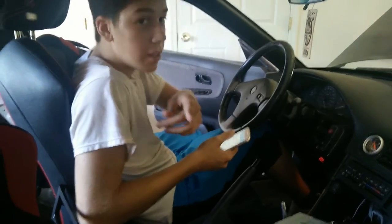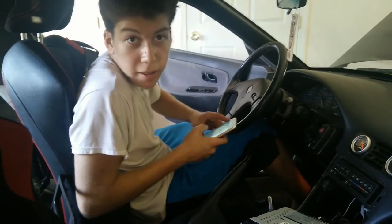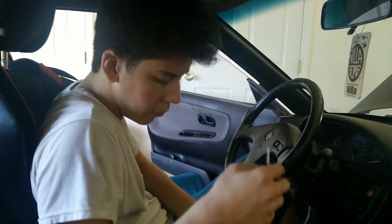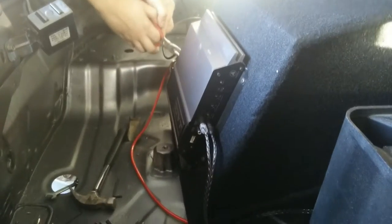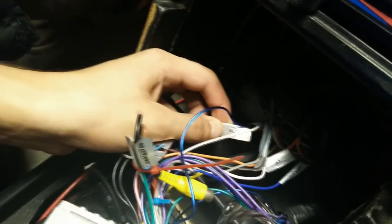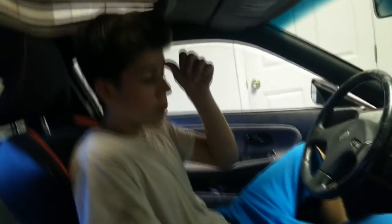Hooking up Bluetooth, Bluetooth life. Not working — yeah, it's not working. You've got to find out what's broken. It's not a big deal, it's pretty simple to fix. We're trying to see if those lights light up, which they're not. The ground is working fine. We didn't know what wire was messing up the whole thing, but we figured it out. I unplugged all of this and reconnected it all. I also changed the remote cable to this red cable — it's called ACC Plus. Yours probably won't be labeled, but it's the power cable, so you can hook it up to the power cable. It's usually red.